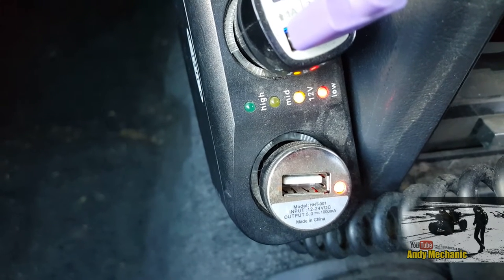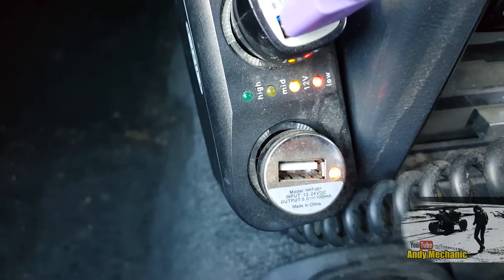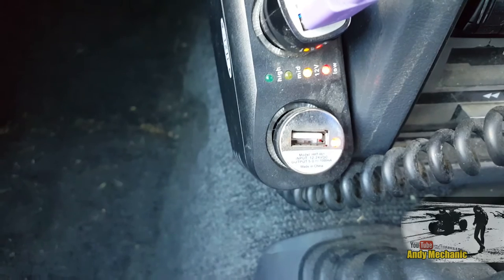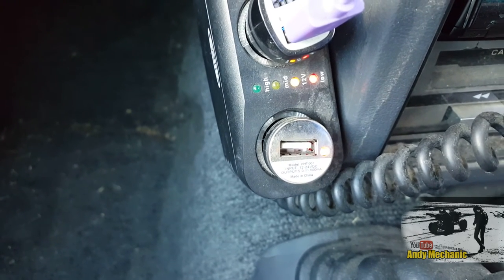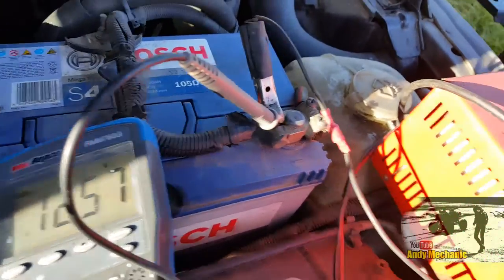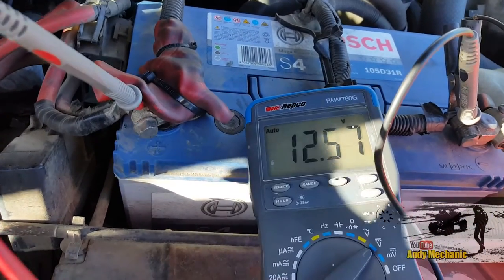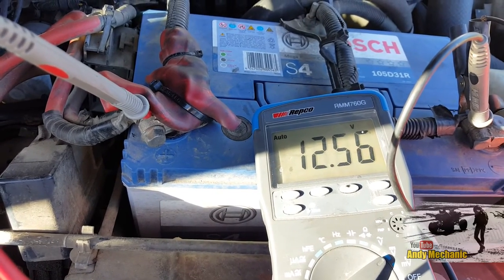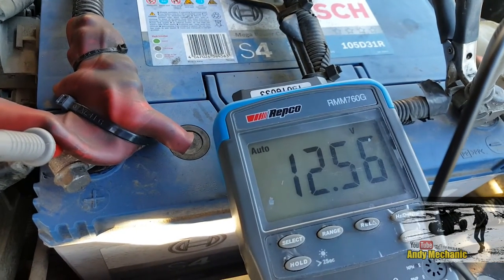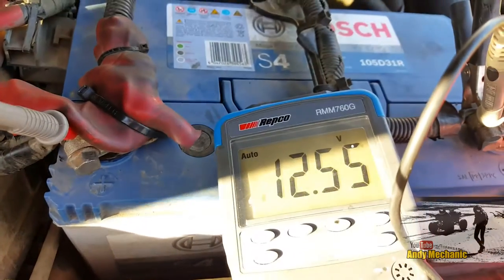The green light wasn't there. So it's time for me to do a check on the battery with a voltmeter just to confirm, because it could be this adapter that's faulty. So we'll get a voltmeter, put it across the battery, give the engine a rev and just verify that the alternator's not charging. The voltmeter's all connected to the battery, I've disconnected the charger for now. The engine's running, so if I give it a rev, we should see that voltage increase considerably. And there's no output, no increase whatsoever, which is telling me that the alternator's not charging.